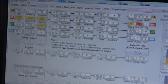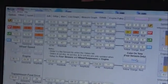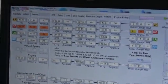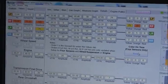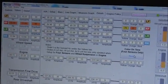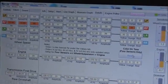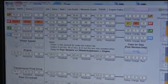That vibration appears to be coming from the outside axle, and we can see that the axle support has some vibration right there as well. But it's mainly coming from the outer sensor that's on the lower arm. So it's not coming from the transmission. That would be on the left front, because I moved that on the tranny and I don't see it at all.